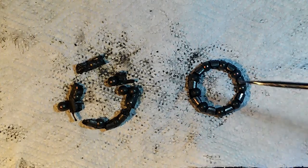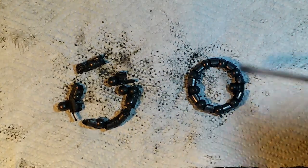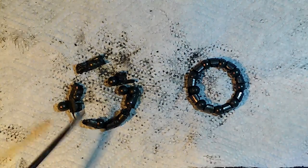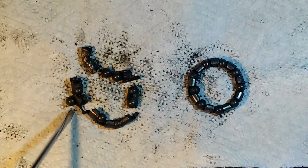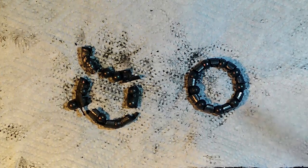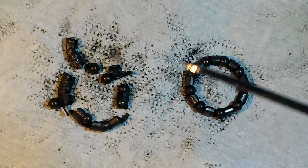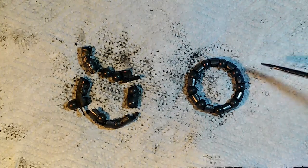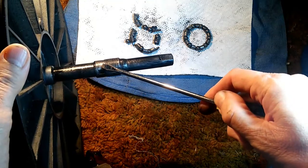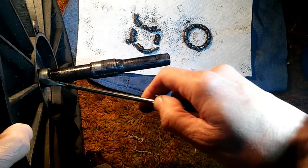These are the bearings from the exercise bike. The left side bearing is a ring containing nine balls — it's intact, but the balls are falling out of it, probably due to wear. The right side bearing is completely destroyed — the ring is broken into five separate pieces and the balls are falling everywhere. Bearings like this are available for sale. The bearing ring is 44 millimeters in outer diameter, 32 millimeters in inner diameter, with nine balls of 5/16 inch diameter inside the bearing race.